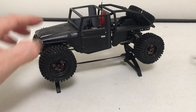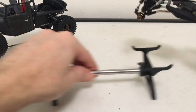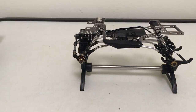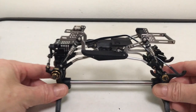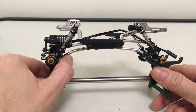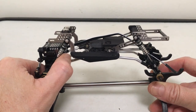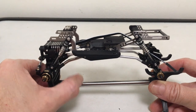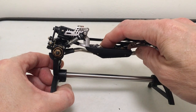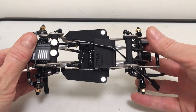I may go back to this one and tweak it a little bit, but so far I think this setup is probably superior — having the transmission forward, the motor forward, getting that weight forward. It took just one turn forward adjustment on the lowers, then you've got to get a custom shorter upper and play with that. I can't beat that right there. Everything else was basically the same — I had to sand a lot more off the inside edge of these sliders to get the body to fit, same Endura spacers for the shocks.